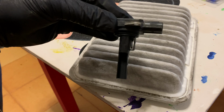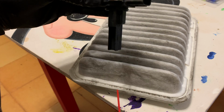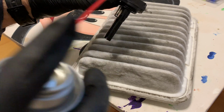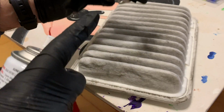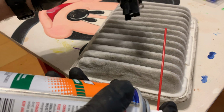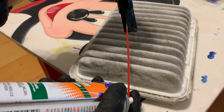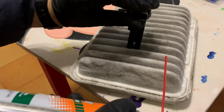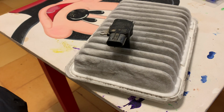What I'm going to do, and I don't know if the light is the best, is clean this little contact here. It's like a hairy contact, two of them actually, using the pressure of the can itself to clean it, and put as much as you can here. And then here you have other contacts inside, so I'm going to put it facing down so that the gunk goes to the old air filter. And that's it. Now I'm going to leave it here.